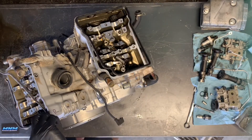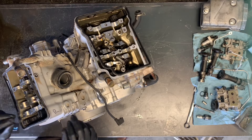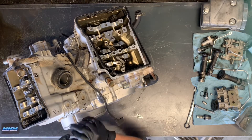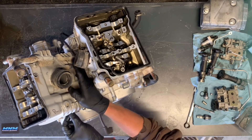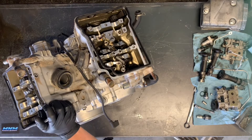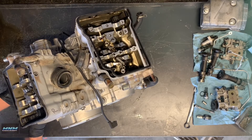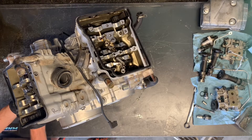The rear cylinder is ready to come off. We've got a rubber gasket that fits down into these camshaft cutoffs — just make sure you don't damage this gasket, they are hard to get a hold of now. We've got 14mm head bolts — four of them here and four on this cylinder. We also have 10mm head bolts down the bottom, 10mm castle nuts right down by your spark plug hole, and a 12mm nut that comes up from the bottom on that stud right underneath your intake. Make sure you find all those before you try pulling this apart. There's also one on the exhaust side under the exhaust manifold. You can pull the exhaust manifolds — you don't have to to remove the cylinder head, but we're going to because it's easier to impact them here while they're attached to the motor rather than trying to wrestle with it on the bench.